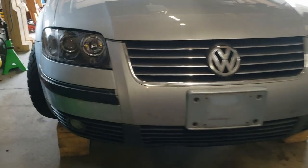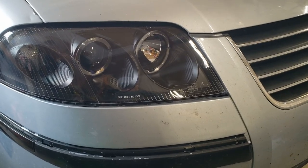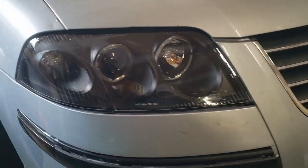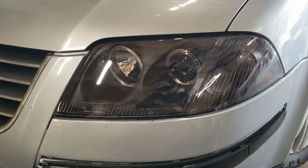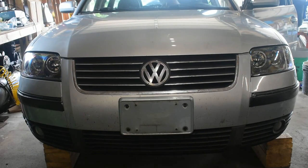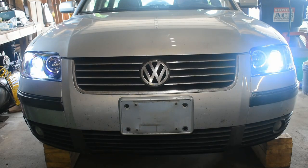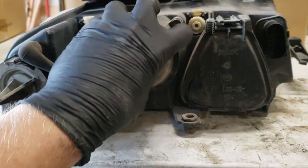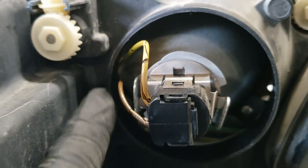Wouldn't it be cheaper just to restore the factory headlights? A DIY headlight restoration kit costs around $50 and two hours of work, one hour per side. We need to price out our labor even though this is DIY — let's say a mechanic shop charges $100 per hour. The entire restoration project would cost about $250. These new headlights cost around $175, and including filming, the replacement took 1.5 hours, making the entire replacement cost about $325. While you could save $100 or more with a restoration kit, many of those kits can never bring the lens back to showroom floor quality, and the restoration likely won't last more than a couple years. Also, looking inside the old headlight units, the internal wiring has been cracking and exposing bare wire — a headlight restoration kit won't fix that.